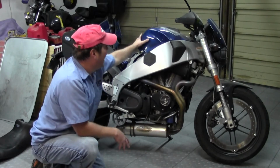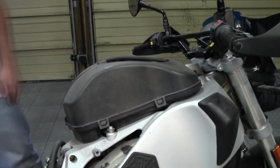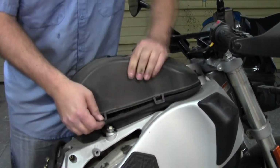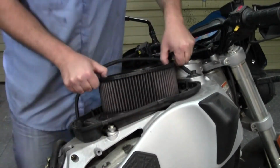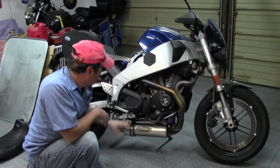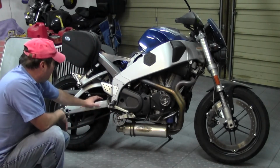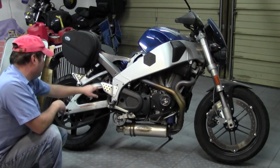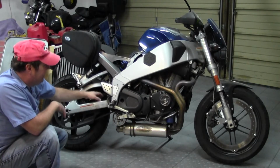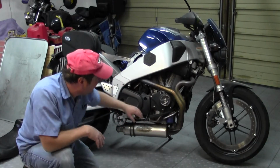Over here, let's move up to the frame. Obviously, you can see here the air box. And why did I touch this and say the air box? Yes, this is the air box. The fuel is housed in the frame on the other side, and there's an electric fuel pump that pushes fuel up into the frame here. That's one thing. Fuel is carried down low, the exhaust, all this, and because it's a Harley-Davidson, it's more or less a dry sump. Where's the oil tank? The oil tank's in the swing arm. Actually, most of it's on the other side, but it's in the swing arm. So there are oil lines attaching to the swing arm that go under and then come up here to your oil pumps and everything.